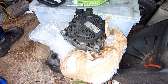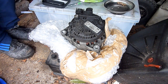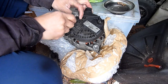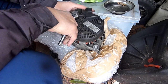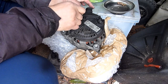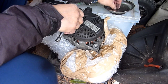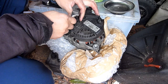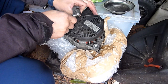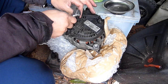So you get the magnetic tray. Imagine I can have a spare one that I know is fully okay to install in the future if the other spare part I bought wears out. They always wear out with the brushes. With 200,000 miles, you've got copper brushes, or whatever the material is, in contact with the copper rotor, I think they call it stator. That's eventually going to wear out no matter how smooth the contact surface is. 200,000 is not bad going.